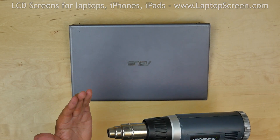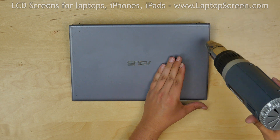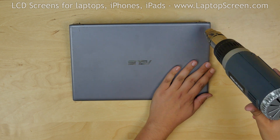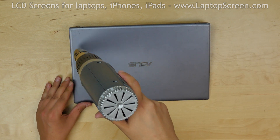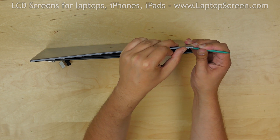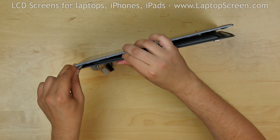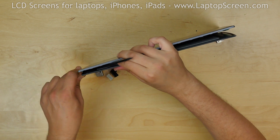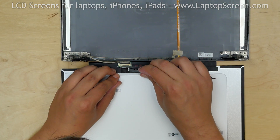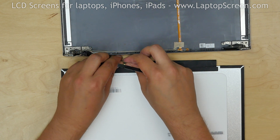The LCD panel is mounted on adhesive. You will need to use a heat gun or hair dryer to warm up the edges of the display assembly from the back. Warm up the right edge, making sure that it doesn't get too hot, then the left edge. Use a plastic pick to begin separating the LCD on the right edge. Warm up the left edge and use a plastic pick to remove the LCD. Peel the securing tape over the video connector, and using both hands, gently disconnect the video connector.